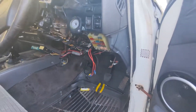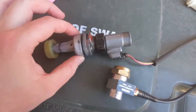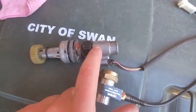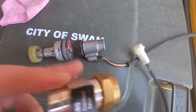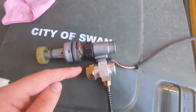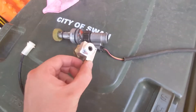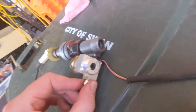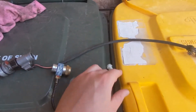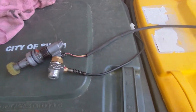I've got the speed sensor out of the car. You can see this is the speed sensor — this little end piece is actually just the adapter, not part of the speed sensor itself; this is the actual electronic part here. What we're going to do is undo this, put it onto the new one making sure we keep the little adapter piece in there so it works and you get drive. It still has a little speedo drive. One thing you may notice if you've got a keen eye is the harness connectors are rather different, so we're going to have to chop and extend them.